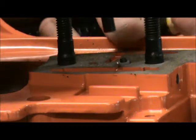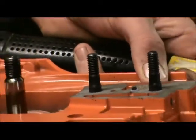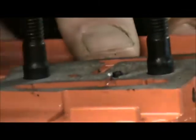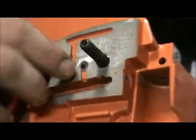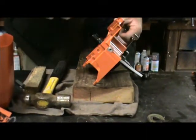I'm going to push this piece from what I saw in that 395 XP: you want the piece of poly pipe flush with the bottom of the countersunk hole. I'm going to finish pounding about another millimeter or two until that piece of poly tube is about flush, and the vent tube is going to stick out approximately half a millimeter.